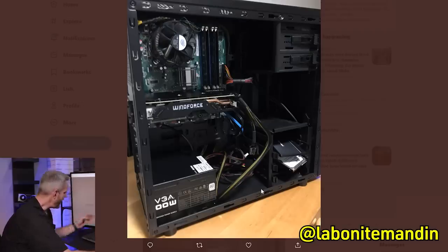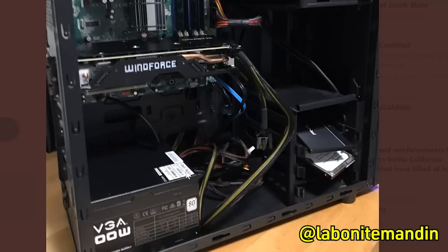But you have the power supply angled the right way. The only time people tend to face them up where the fan is up here is because they don't have enough clearance on the bottom to get air up through it, carpet, whatever, the case design, there's a lot of factors for it. But if you flip it the other way, the cables coming out of one side end up closer to the side panel rather than the back motherboard tray, and that will eat up a good 6 inches or so of cable length. And like we showed earlier, sometimes they won't reach.